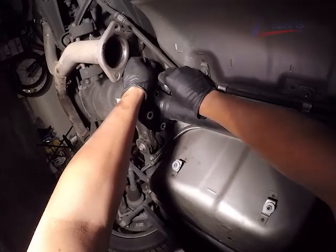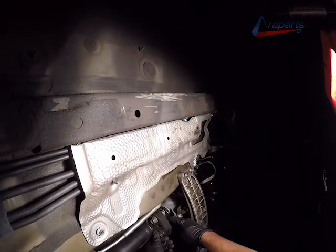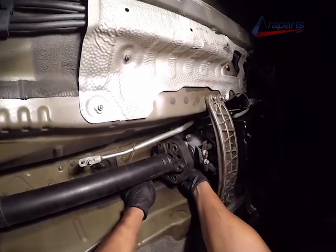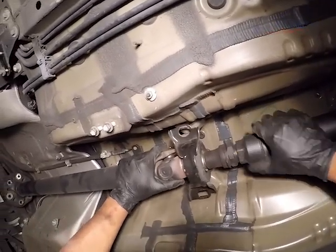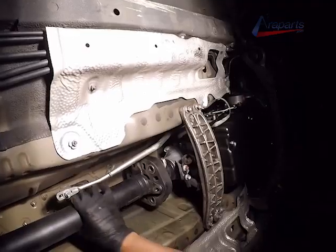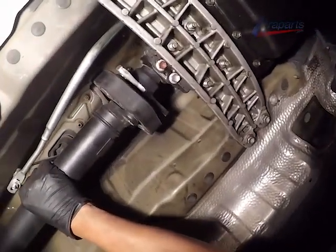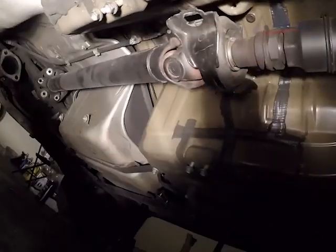And now we're removing those last few drive shaft bolts. We're going to loosen them up and get them removed. Now I'm going to completely remove the center bearing bolts, and now the drive shaft can come off. I'm wiggling it out here, and again, for the rust belt Eastern vehicles, this part would probably be a little bit challenging, much more difficult than a car without rust.